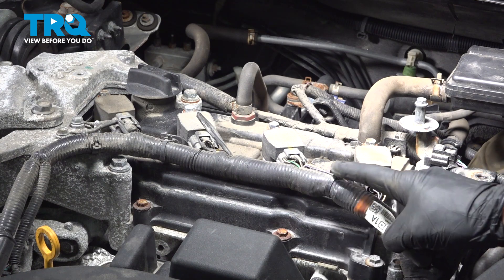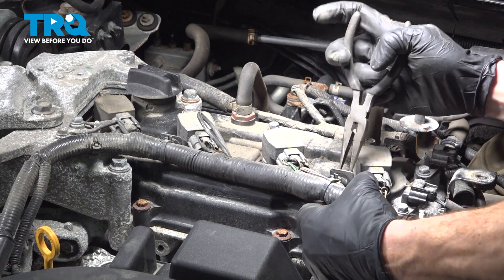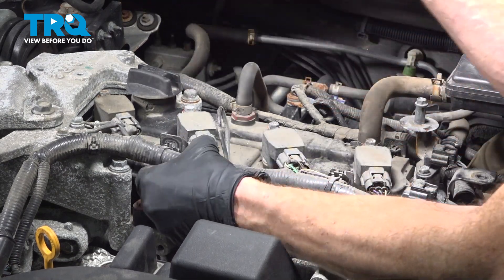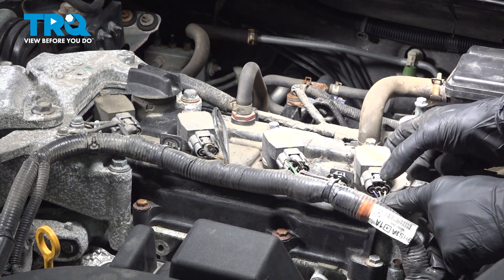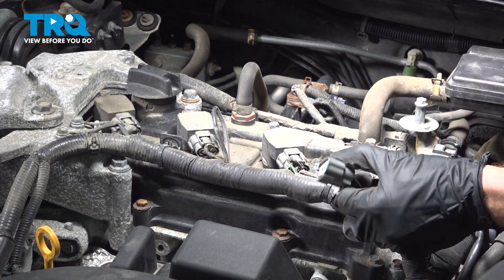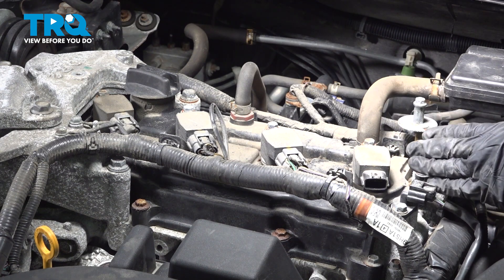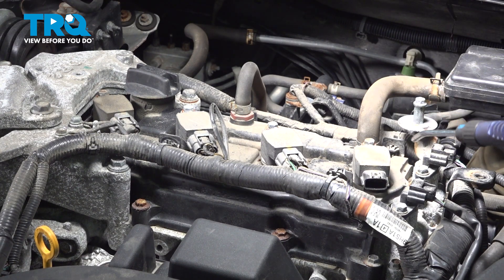You will find that the wiring harness has two mounting points. To dislodge these, you can use some long nose pliers — there are little tabs along the back side. Squeeze those together and then separate it. To start disconnecting the ignition coils, along the top there is a locking tab. Press that in and then gently separate it. Give it a quick check for corrosion. Assuming it looks good, set it aside. Before removing the ignition coil, make sure you do not have any debris along the top of the valve cover that may fall inside. We'll use some compressed air.